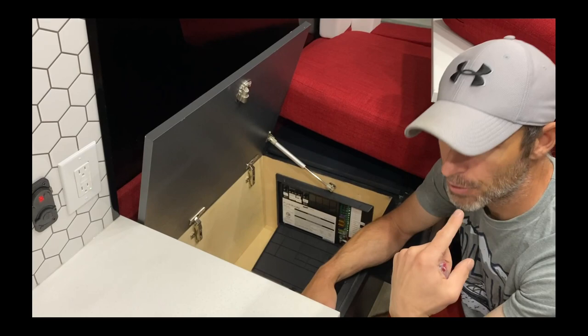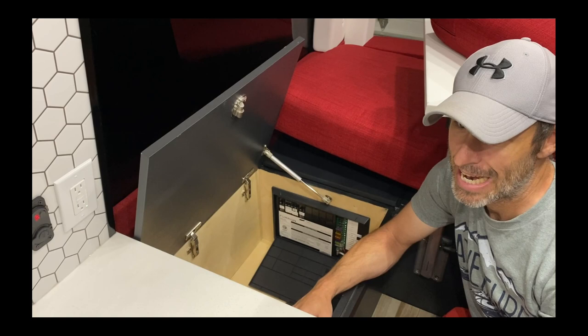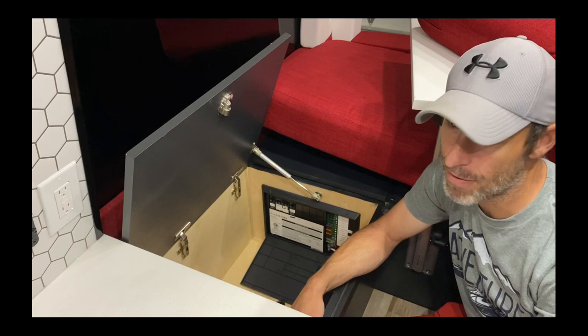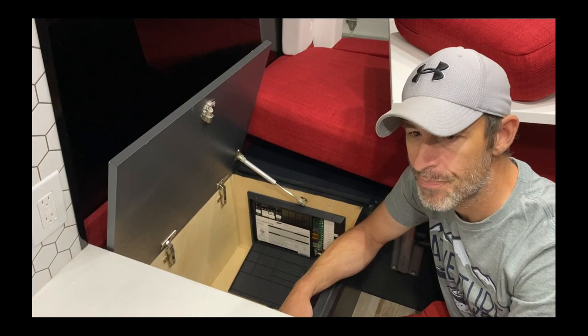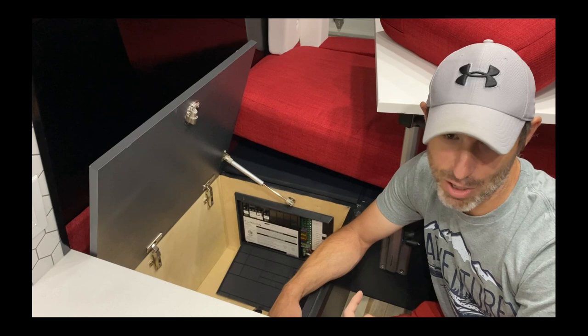You're also going to be getting solar. We were testing your solar pretty heavily the last couple days and the roof rack over here is blocking part of the panel, which is really impacting output. You have 200 watts but you're typically getting like 60 to 70 watts. We tested everything, ripped it apart and tested it again — it's getting power, but it's partially blocked, which limits the total input coming in.